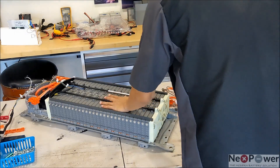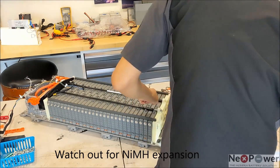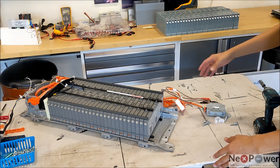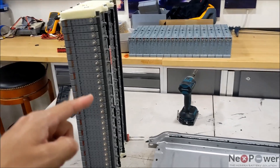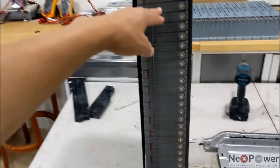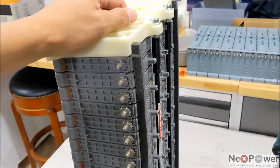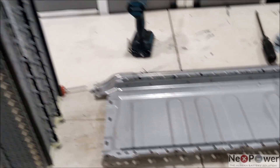The battery is cooling — it's around 85 degrees. When you install the battery back, it might be a good idea to stack it vertically, especially for nickel metal hydride batteries, because they actually expand a little bit. You can use gravity to push down and make it easier to fasten the bolts. This is not necessary for lithium battery because it doesn't expand at all, so you can just horizontally stack it in and close the loop.